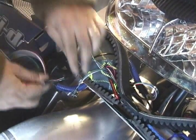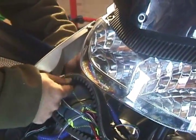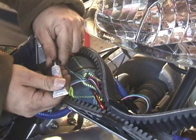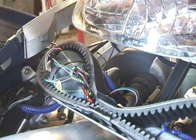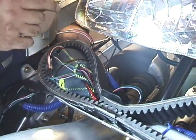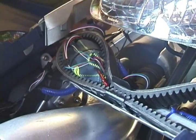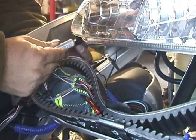I'm going to put in the Y connector. I want to make sure that these wires run behind this belt, so I'm going to push that through and get my grease. I picked up some dielectric grease — this will just help keep debris, snow, and moisture out of these connections. You just squeeze that in there; it's two dollars a tube so it's good insurance. I've connected to the remote box and have two offshoots on the back. I'm going to bring one back around and reconnect to my original connection, which already has grease in it, and come to the connection that will go back to the Ys — those will be my running board leads.